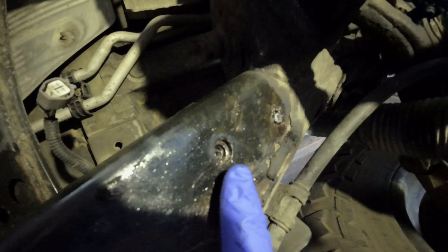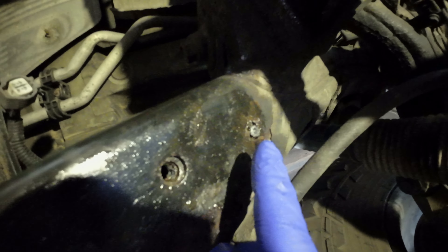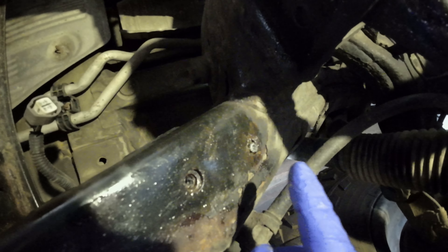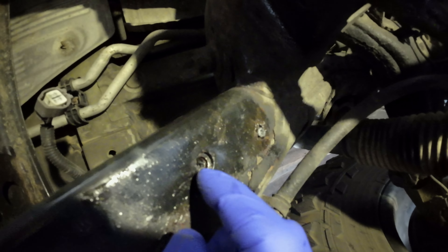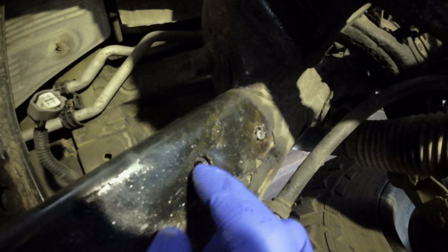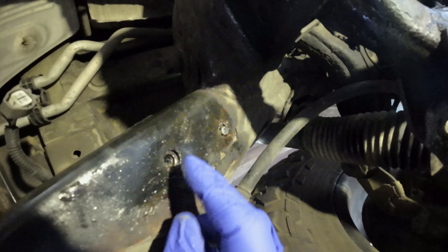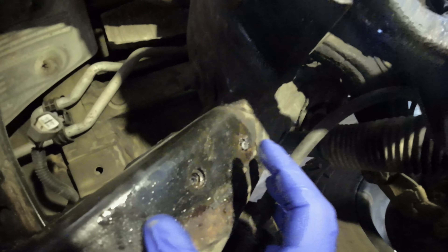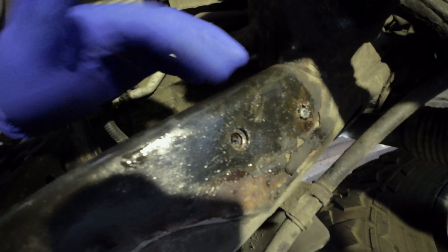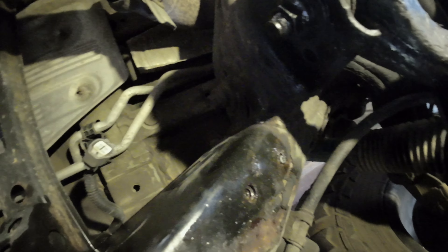We got one of the holes drilled out — not tapped yet — and we're working on the second one. So we've got one down and three more to go. What I'm doing is drilling out the rusted bolt that's in the frame. I don't mind if I mar up the threads in there — I'm then going to put in a tap and re-tap a new thread pattern. If this doesn't work, I can move on to throwing nutserts in there. And if that doesn't work, I'll grind the frame out and literally just weld the bracket on. Because once I put this bar on, I'm planning on never taking it off.